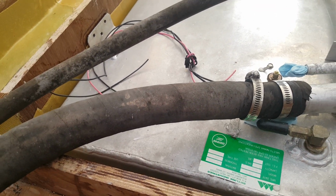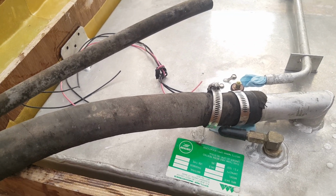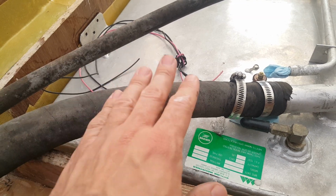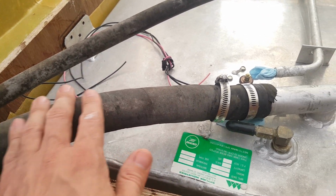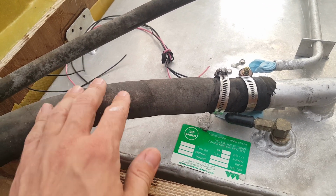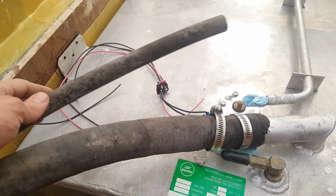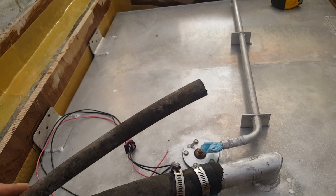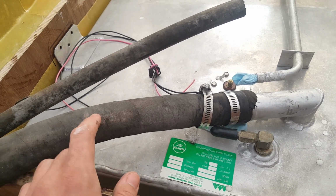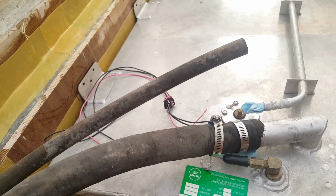The new upgraded 1.5 inch fill tube that I found by Sierra seems to have these little ribs in it, which are going to allow for more flex, whereas if you notice, this is just a fire resistant coating around your typical rubber fuel line. That's another reason too, by the way, because most fuel filler hose may or may not be rated for fire, and this one is. That's kind of what this outer surface is, so it's got to be fuel rated.